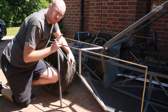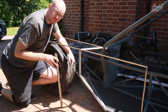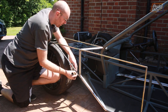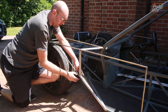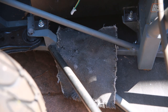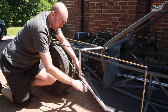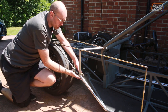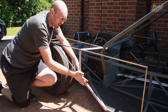Now I've got the outer wing framework in, there's one more piece of support we need to add — just to stop this from flexing side to side. I'm going to put this piece of inch tube in from the lower suspension mount at the very back of the swing arm onto the inside edge of this corner. This gives us a nice big triangular structure under here, a really good brace, and we can mount all of our inner wing structure off this as well. This really finishes off this section and adds a huge amount of lateral strength to the car.